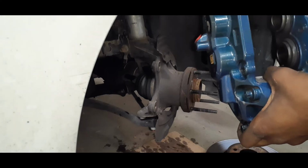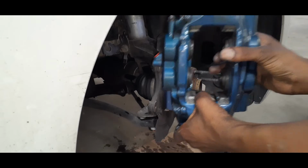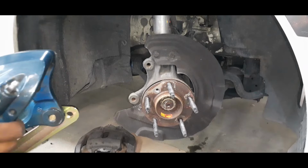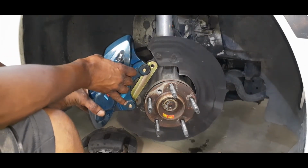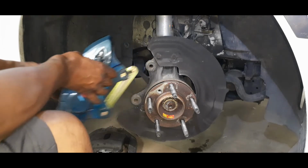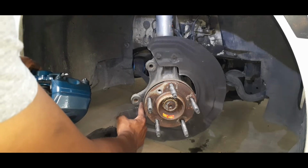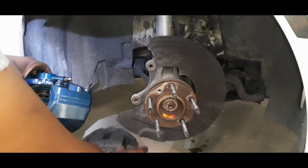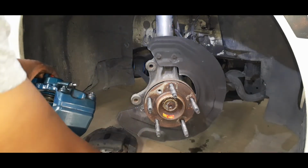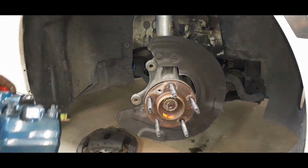I haven't done it yet, so you're pretty much finding out at the same time that I do, but as far as what I could see, the top pretty much lines up fine, and it's the bottom you have to cut into the heat shield. Looks like right about here, so I would come in and cut straight down. Might need to cut over a little bit more, but basically it's test fit, cut, test fit, cut until you get it in there like you need it to be.